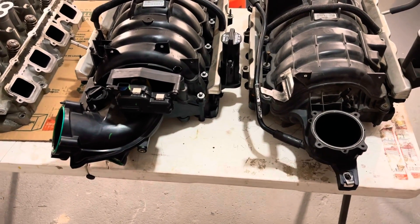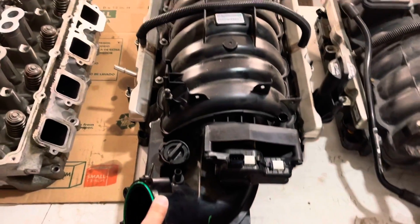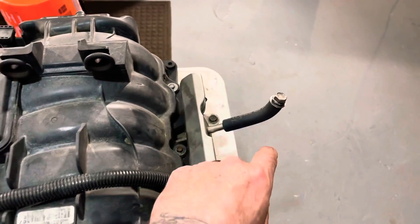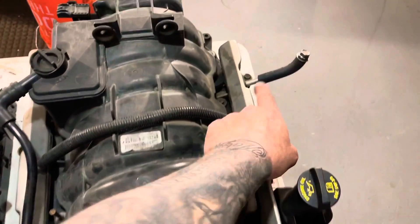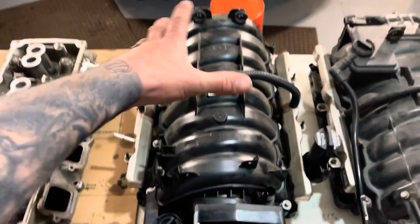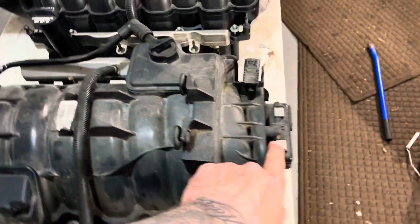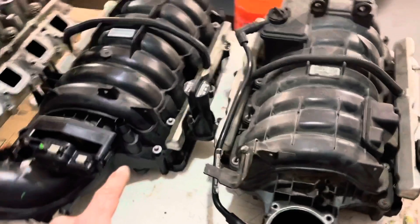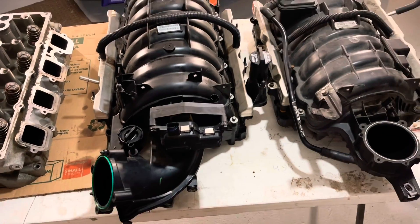When you get the 6.4, you're going to have to swap the fuel rails — that's pretty simple. The fuel connection is on the left side on the 6.4, so you just swap the fuel rails. Number two: the motor for the active runners on the 5.7 is in the back, so you are going to need an SRV connection — I got one from Takamaya Sam — it connects to the front on the 6.4.